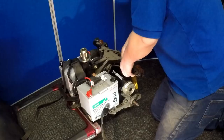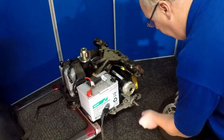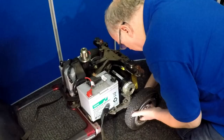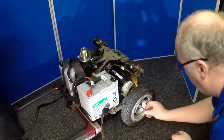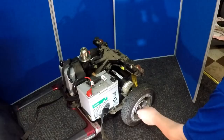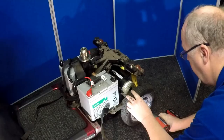So I'll just throw this back together again and we'll take it for a test drive. One thing to remember when reattaching the wheel is to ensure that the woodruff key goes in — that is very important. That's it on. Also what we tend to do is put a bit of thread lock — medium strength thread lock. Do it with your fingers first, don't do it with the impact driver. Let me check the torque setting — there you go. That's it nice and tight.